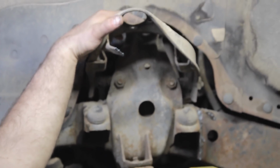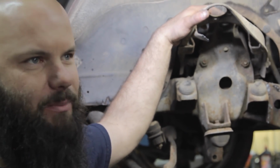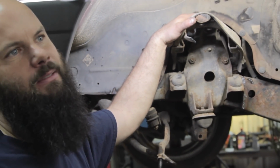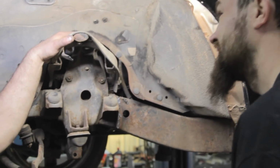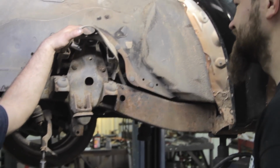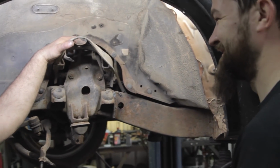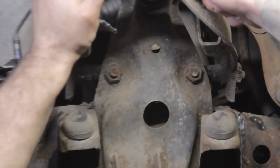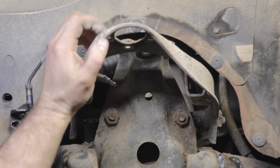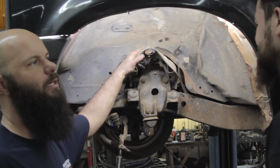Why do you want to cut this off? So we can design a proper suspension and not try to recycle something from the factory. But everything from the factory works on this truck. Yeah, it works at a stock height or lowered 3 inches, not laying frame on a 29-inch tall tire. You see the angle of that upper ball joint, Kyle? Ain't gonna work.